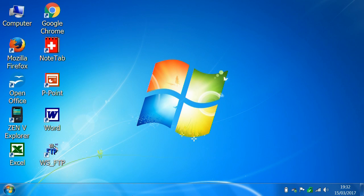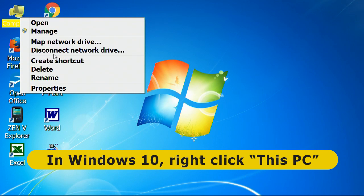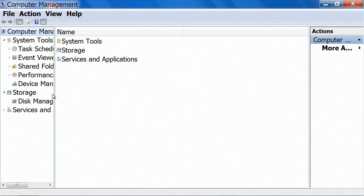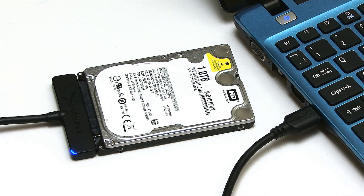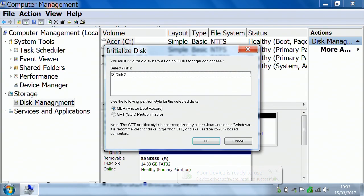I thought I'd finish off by showing you how you set up a new drive — whether you put a new disc into a cartridge, or inside an enclosure. Here I'm in Windows 7, but it's pretty much the same under Windows 10. You just go to Computer, then right-click and go to Manage, and that will bring up Computer Management. I'm going to plug in one of my new one terabyte drives via a USB to SATA interface, just for testing and setup purposes. It's all ready, except of course it isn't — if I click on Disk Management...